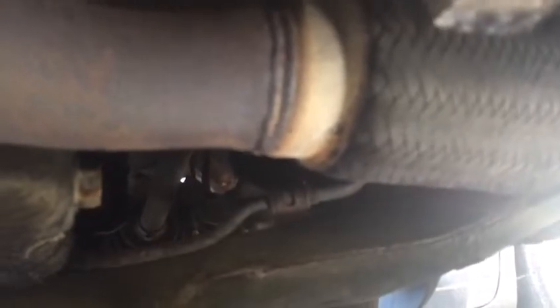This replacement was purchased from Germany for under 25 pounds, and it's not going to be clamped — it's going to be welded, because our pipes are not round. You cannot get a clamp on them; exhaust gas will leak around it because they are not round. Here it's a little bit larger in diameter and slowly gets narrower, so we couldn't fit one of those clamp-on fittings you can purchase online.